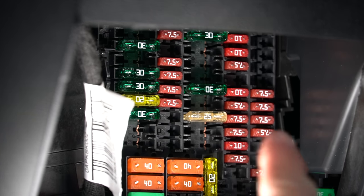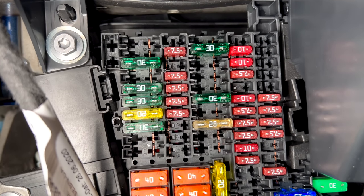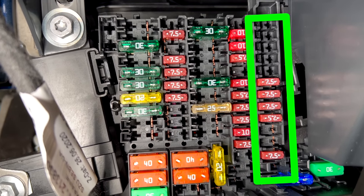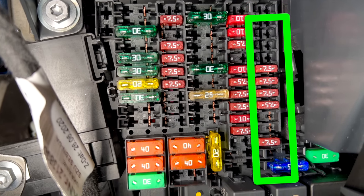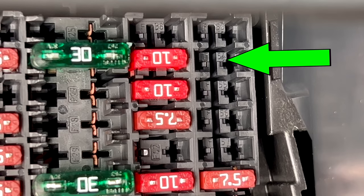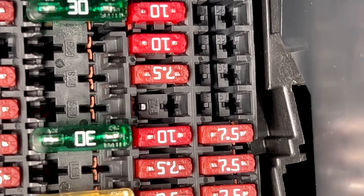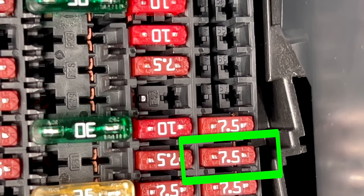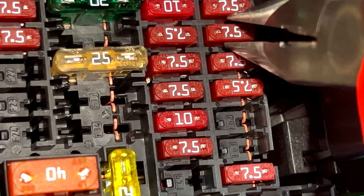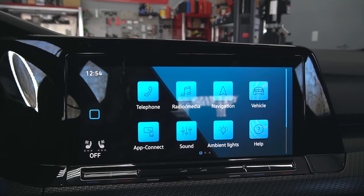With our cover off, we can see our SC fuse panel in the car. The fuse we're looking for is number 59, and that's going to be all the way to the right as you're looking at it. In that far right row, you can see that they're actually numbered. The top one is F53. I have a bunch of blank fuses — the first fuse location I have filled on that side is 58, and then the next one down, 59, is the one that we need to pull. Grab that second one down, number 59.